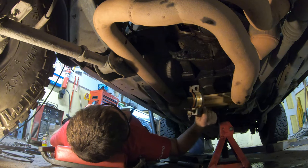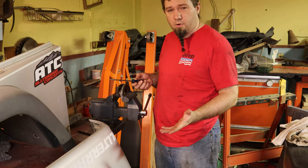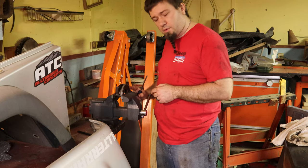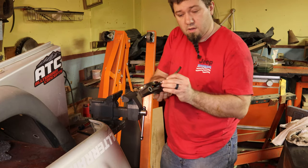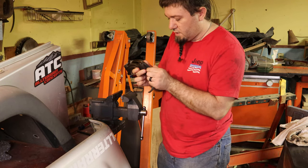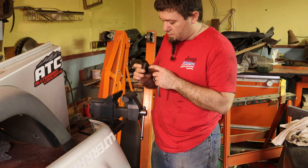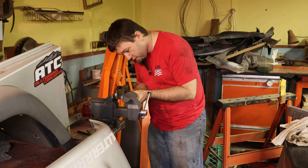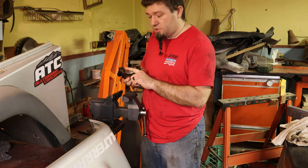There it is - one retainer cap with half a rear main seal in it. This side of the shop is not as well lit, but this is where the bench vise is. There are two things I need to do here. One is around here - you can see this gray stripe - this is what's left of the oil pan gasket that was stuck on there when I took this retainer off. See the groove? It just kind of peels right out of here. There's some RTV in here, and I'll show you when I reinstall it about the RTV. One thing I want to warn you: this thing is machined steel and these edges are sharp - legitimately sharp.